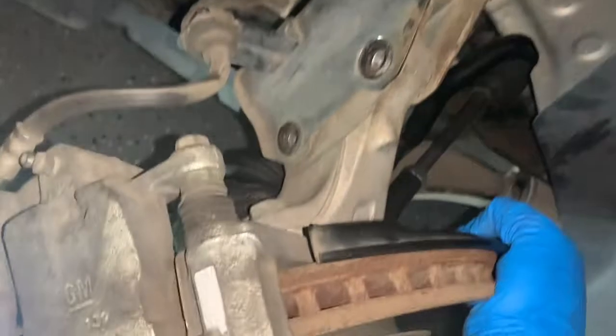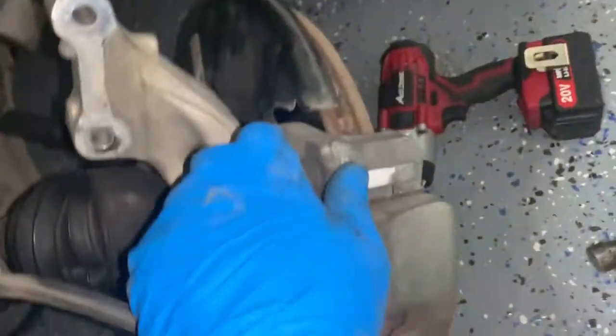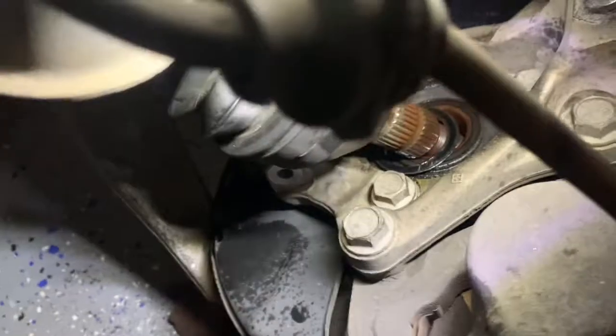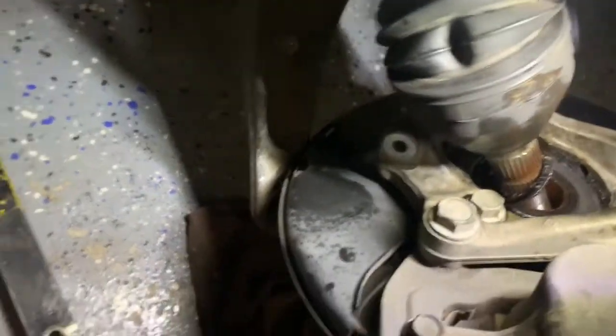This might be a little easier to move now. I got this part off and I'm trying to get that out — just moving the entire brake system and the assembly for the top out. Hammering the axle from there and as you can see it's coming out. Got that basically all out — see the washer there. What I did is I hammered from the front, let it move around, and as you can see it's almost out. Just gonna move the housing forward and the entire thing with the axle boot will pop out. Got this out.